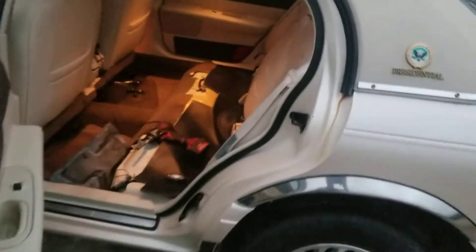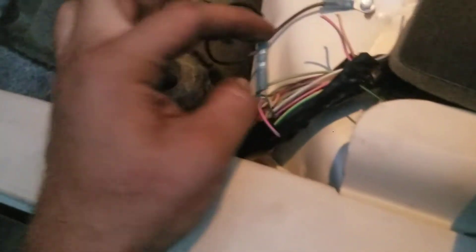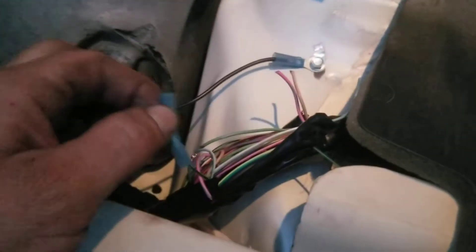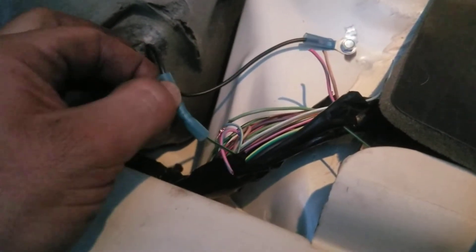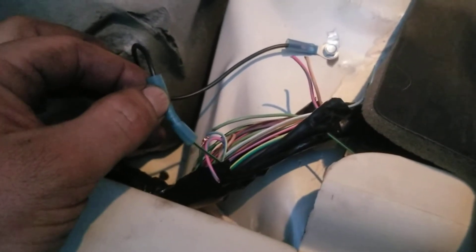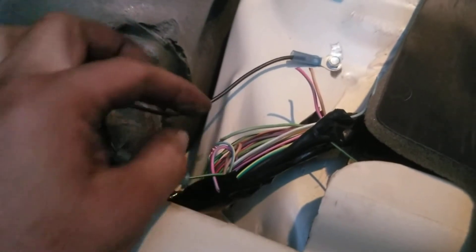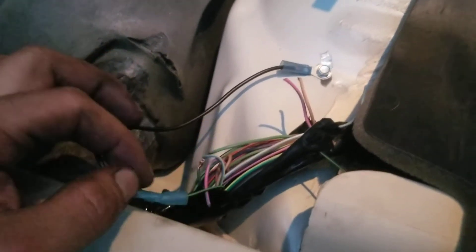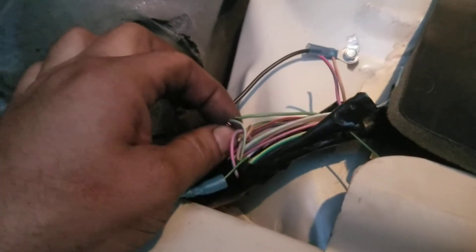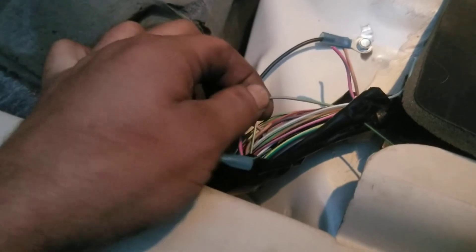After a lot of digging, I found on a forum the wires that you have to mess with to get rid of the light on the dash. The light green wire with a black stripe you have to ground, so that you have easy power steering — otherwise the steering gets hard. The light green and purple wire has power; you have to feed power to it.